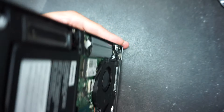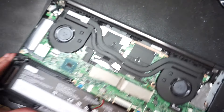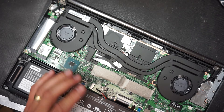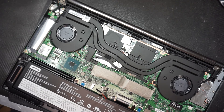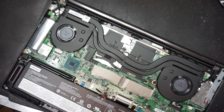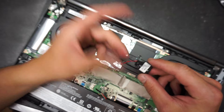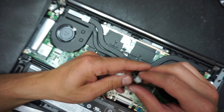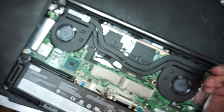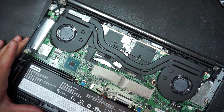That should be about 30 seconds. Now I have to plug the battery back in. Most of the time this works, however in some cases a secondary battery will also have to be removed. This is the secondary BIOS battery, which might look a little different depending on the type of Yoga computer you have.